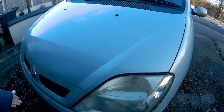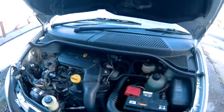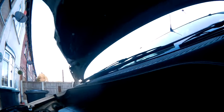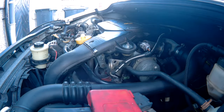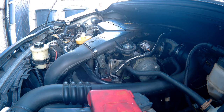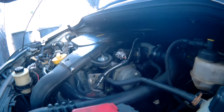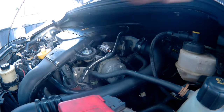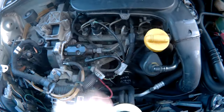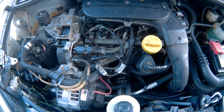We've got this 2001 Renault Scenic that started running like it's got a misfire. One of the engine lights has stayed on — the one for the heating elements, glow plugs. So I'm going to remove the glow plugs and test them today, and if that's not the fault then I'll have to start investigating the injectors.